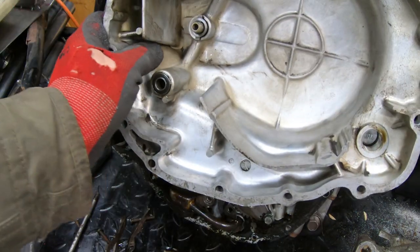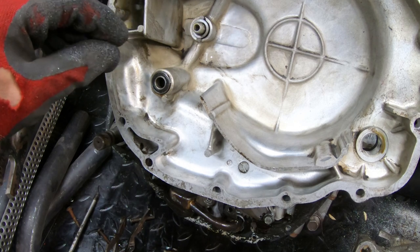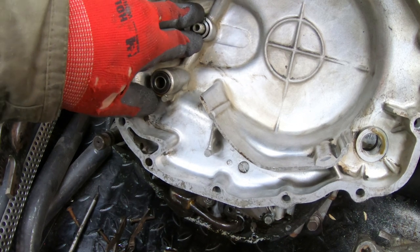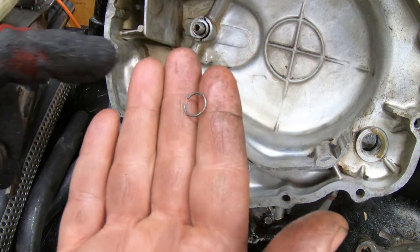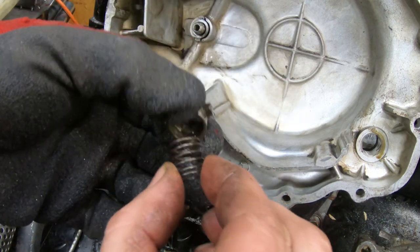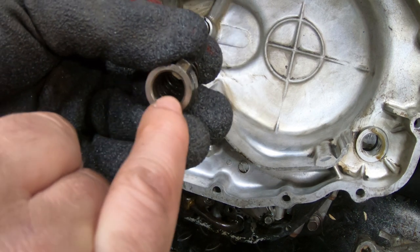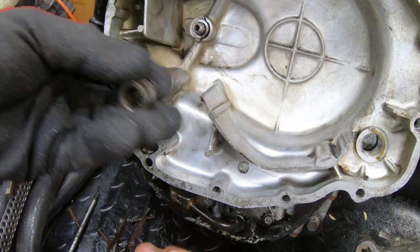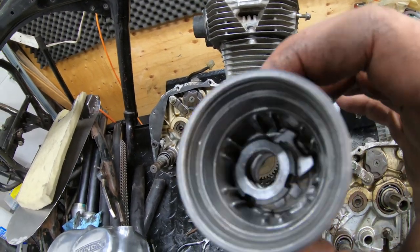So that's the side cover. Apparently at really high RPMs, this is the oil passage — apparently with thicker oil and at high RPMs, a bad combination of both, this little spring-loaded guy doesn't allow enough oil to pass. So I took the donor cover and I've already popped that guy out. There's a little spring retainer right there — it's a bit of a pain to get out but doable — and then it's just this guy with a spring. The mod is to take a Dremel and just open up the two sides just enough to let a little bit of oil through on both sides.